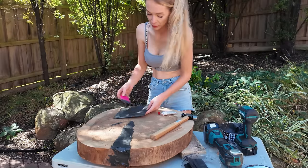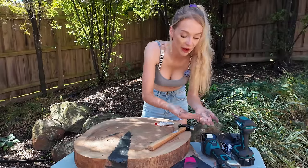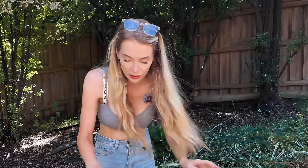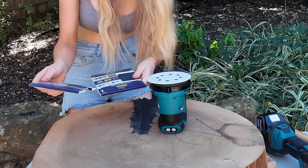I'm going to leave this for about an hour because it's quite thick. I might just go to Bunnings and get some more plants because I need to finish more of the gardening. The next morning - I put more carbon filler on last night and wanted it to really dry. It's a little bit sticky now, maybe because it's warm outside - it's going to be 37 or 38 degrees Celsius today. I've got an orbital sander now as well - I thought my last one was orbital but it's not, so this should be easier to sand. I'll use 40 grit.